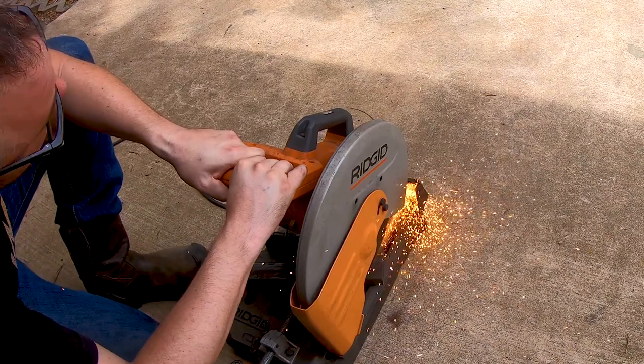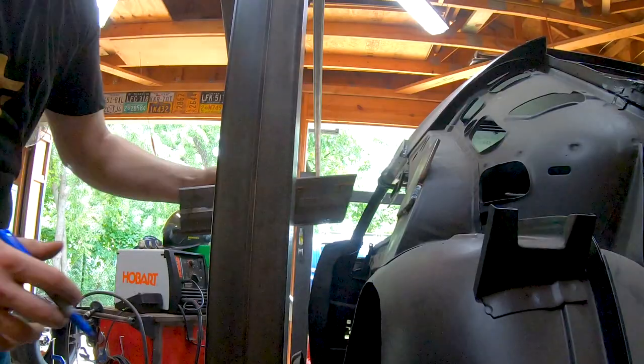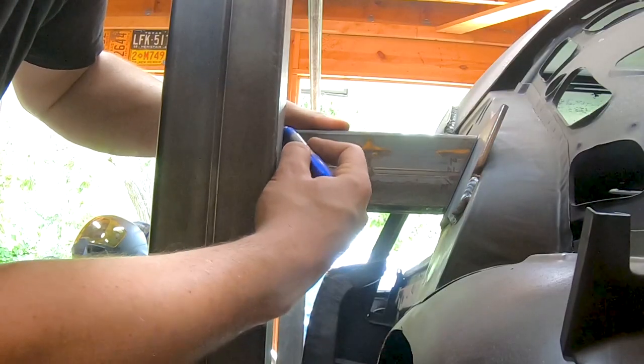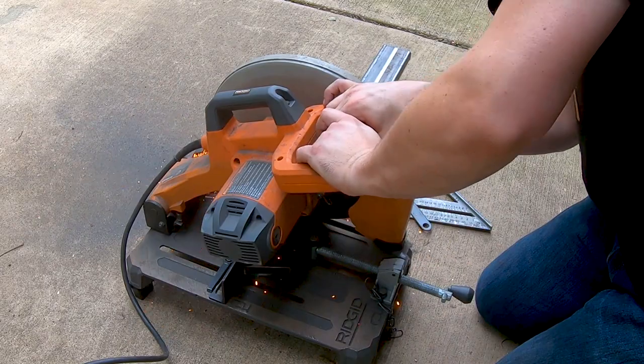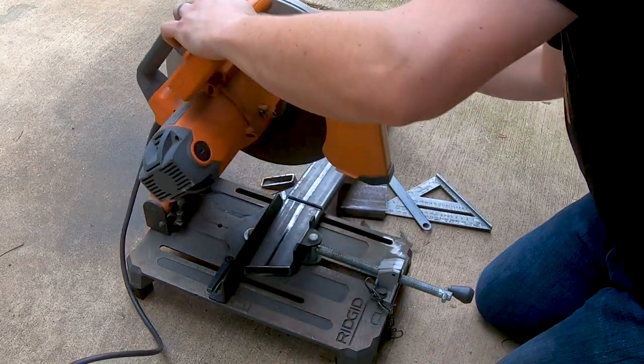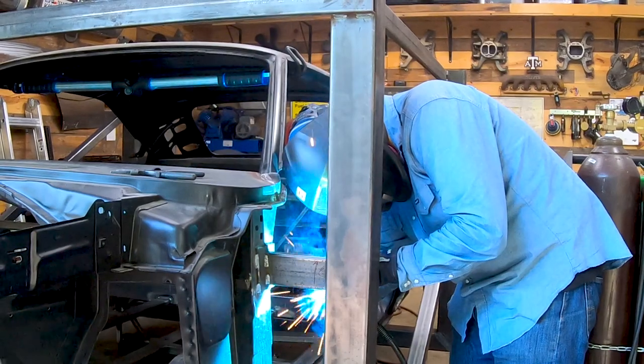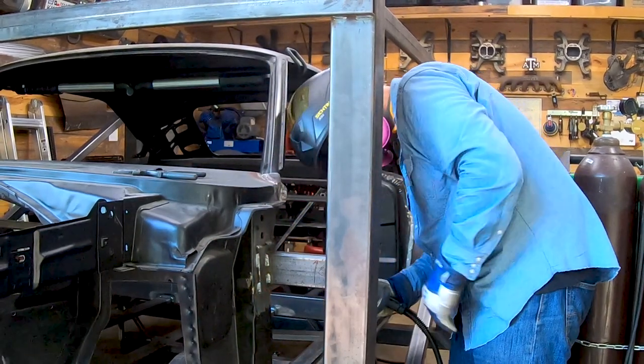Lastly, and this is where we get current, I threw on a big lateral brace to stiffen up the whole assembly. And with that, the car is locked to the frame table and the unibody shape is secured and safe. Now, I can remove the rest of the Rev1 chassis without the car collapsing in on itself, which is what's about to happen.